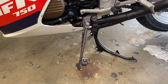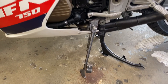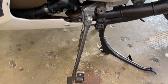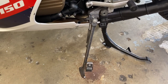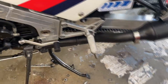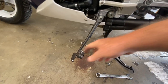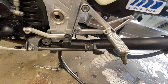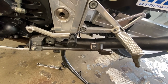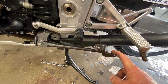We've got a center stand, and what I did was I pulled the trigger on buying another side stand — it comes with the bracket, the pivot bolt, the whole bit from eBay. So if I screw this one up we'll just put that one on. I planned this out as far as where this thing is going to land when it's longer — you have to do this. I read about a guy on the VFR Facebook page who extended it by 38 millimeters, which is an inch and a half.